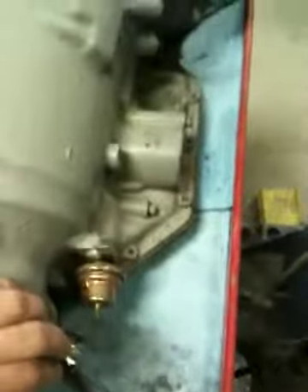All the hardware is new, the vacuum modulator is new, this kickdown thing is new. And it had a leak problem because this O-ring on the dipstick filler was broken and it had all that goo on it, but I think we can fix all that up.